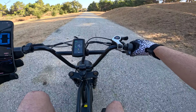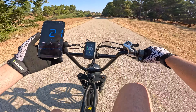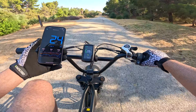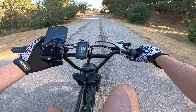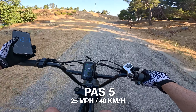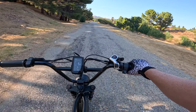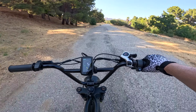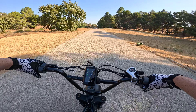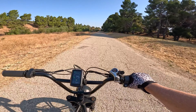There is a key, but it's only used to remove and lock the battery. Super simple — you have a power button right in front of you, hold it for a second or two and the screen comes on. The bike starts on zero mode, which means no throttle and it operates like a normal bicycle. There are five modes: one through five. Once you're out of zero, the throttle will start working, and the throttle gives full power no matter what pedal assist mode you're in. The modes are directly correlated to the pedals. The bike does have brake sensors, but they're right in front of you so you can disconnect them if you don't like that feature.